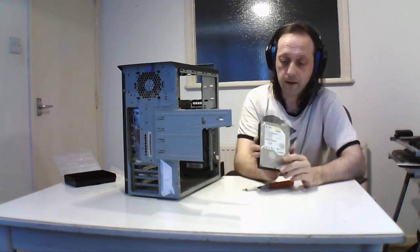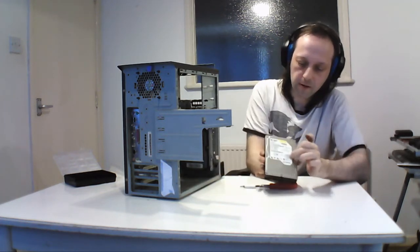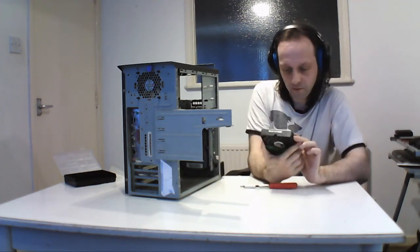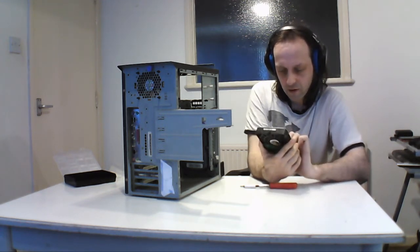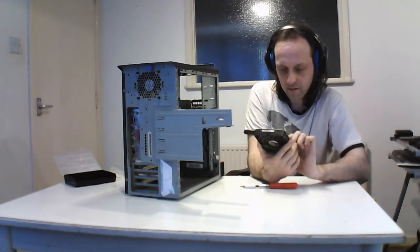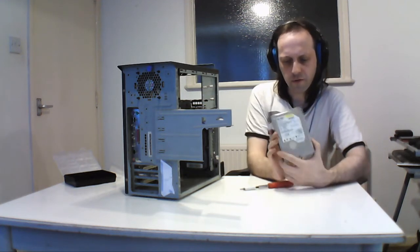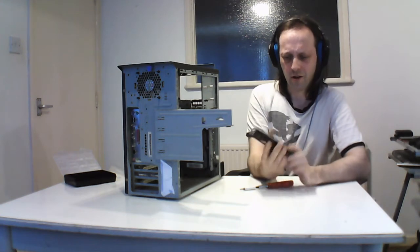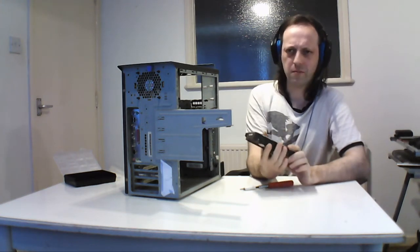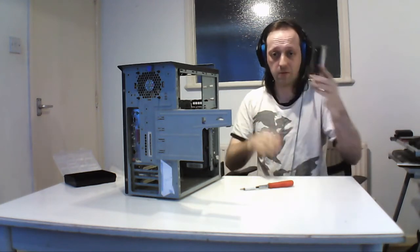And the same thing. There's a jumper controller here, and normally on the front here it tells you which way to fit the jumper. So this one's set to slave because it was the storage. You can set it with master with present, master slave, and cable select. So yeah. So this is the storage drive. And to be honest, I forgot what I put on this system, so I want to check that out. But that's what the test system's for, to plug these in to test it. But yeah, so that's one storage.